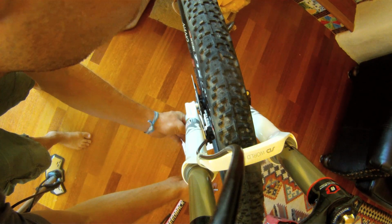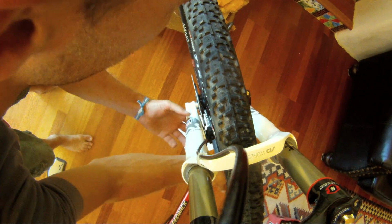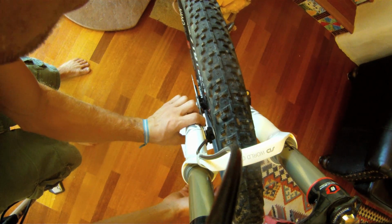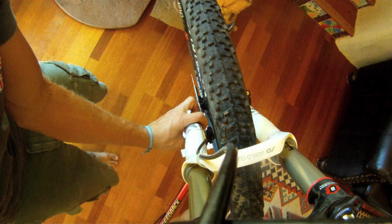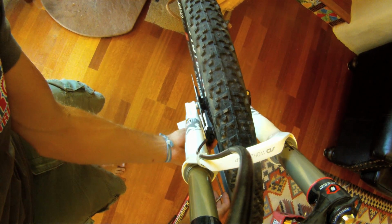and we're going to try to center it by hand, which, really use the other methods if you can, but if you have a really stubborn brake that doesn't want to center, that's how you want to do it. So I loosened both of them, getting good movement in there. So go ahead by tightening the top one just a little bit, and I want to look down through there as I'm tightening it to make sure that I can see the white paper underneath. I need to push it over a little bit.